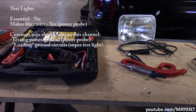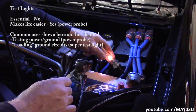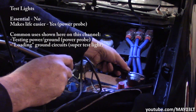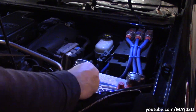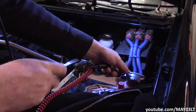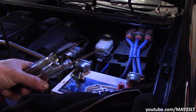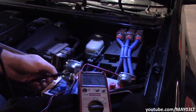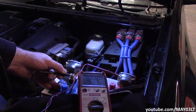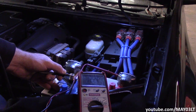Next up is test lights. The way a simple test light works: you attach one end to the negative battery terminal, touch the positive, and this test light lights up. It can also work the opposite way — you can touch the positive terminal with your clamp and it will also light up the lamp. We've also got this computer-safe test light that just lights up a little LED inside. You can reverse the way it's oriented and it will still light up. Now, based on what you saw from these test lights, is the battery in good condition? We're sitting at about 12 volts, which is a little bit low — but there's no way we could have gotten this information with the test light. While the test light may give you a quick go/no-go, it is not a substitute for a meter.